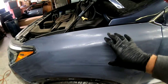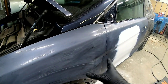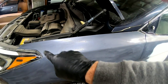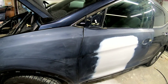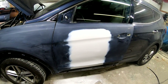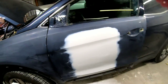For the fender and the area around the primer, we need to prep those out for a paint blend. I used an orbital sander with 600-grit sandpaper to machine sand the large areas, and then went around the edges by hand with a Scotch-Brite scuff pad equivalent to about 800-grit. In some areas I used a 600-grit foam pad as well. You can sand by hand or wet sand with 600-grit wet-dry paper. Your main focus should be to make sure all the edges are sanded and all the shine is knocked off for clear coat adhesion.